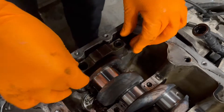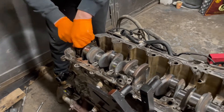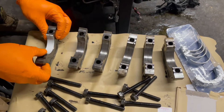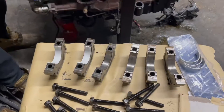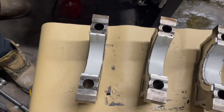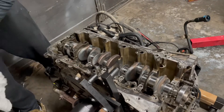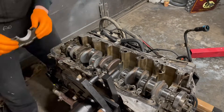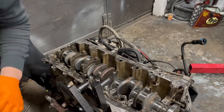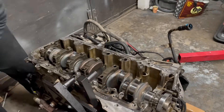As you can see, these are the old bolts for the test — they're fine to use here. Once I'm finished, I have brand new original BMW bolts I'll use for the final assembly. This is a very slow process; it's a bit boring, but basically this decides if the rebuild is going to be a success or not. I'm not using the assembly lube at the moment — just putting back the caps. I won't turn the crankshaft; it'll stay in place. Measure twice, cut once, as they say — I'm being very careful not to make any mistakes.